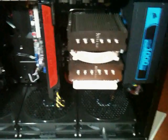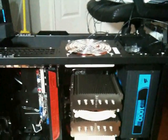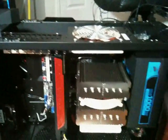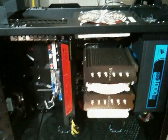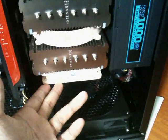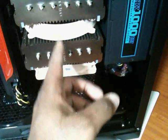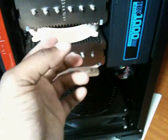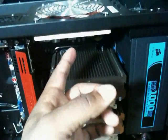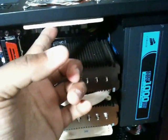These three large fans are intaking cold air from the bottom and pushing all the cold air up and out of the case, simply because warm air naturally rises — and I think this is a very innovative technique. This 120mm fan is intaking cold air and pushing it through to the 140mm fan, which is exhausting up and out to this 120mm Noctua NF-P12.